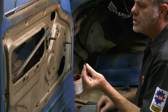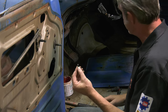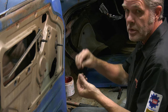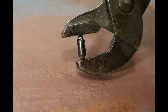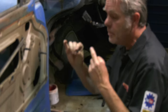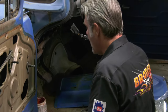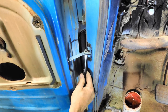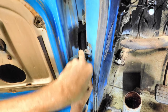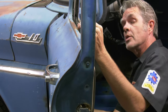The little trick we've got for these is that you'll need to flare out both ends. What we're going to do is put a BB right on top and right on bottom after we install it, and then we'll use some channel locks or vice grips to clamp down on that. That'll flare out the end on the top and the bottom, and then we don't have to worry about this falling out again. You're going to need to line up all of your holes here, get the pin started, then get your BBs on and flare out the end.